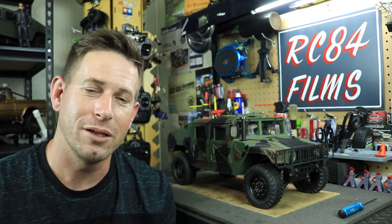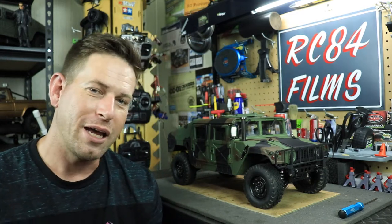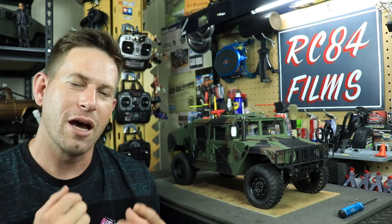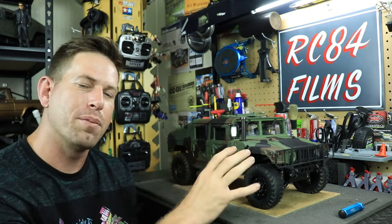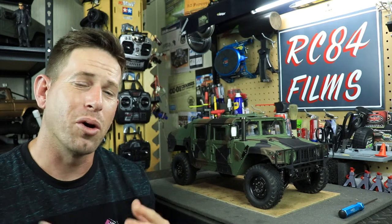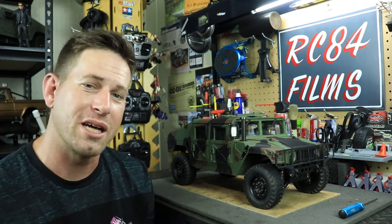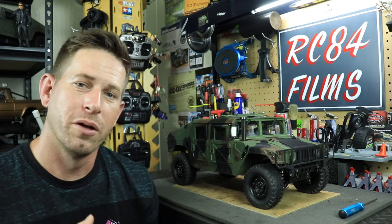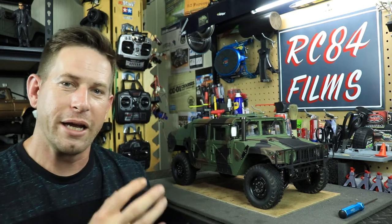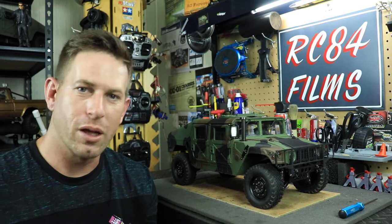RC84 here. Like always, thanks for watching and welcome, my friends, to part one of Project Humvee. In this video, we're going to be working on getting the stock electronics out of the vehicle. To do so, I have to remove the entire body off the chassis because the body is attached to the chassis. There are a total of 8 screws. 6 screws are the main screws that hold the body shell to the chassis, and then there are 2 screws that hold an exhaust bracket on that I had to remove. Once we do that, I can get into the electronics and start replacing those with my new electronics.